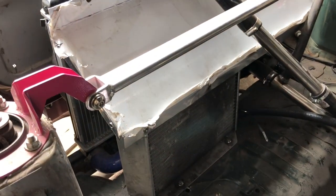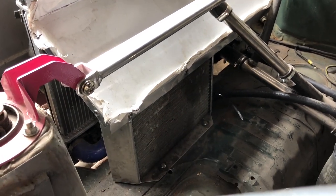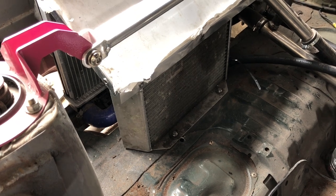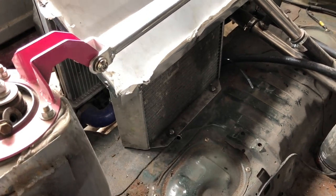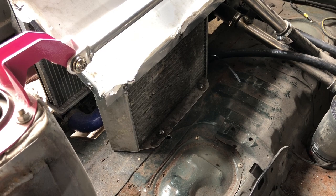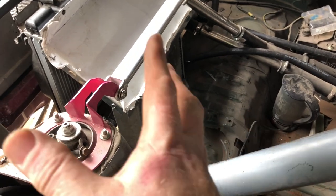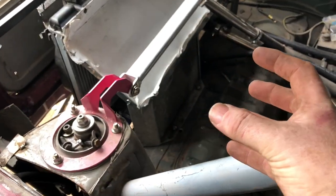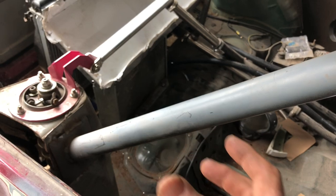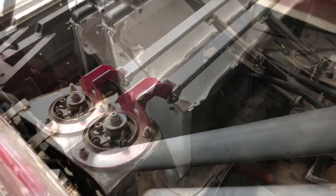Now we can start making the sides and front, which should be fairly simple. I could even reuse the rivet nuts we've used there if I want to go straight across flush — that could be an option. Though I do think I could do with a bit of space before the radiator for the air to expand, otherwise the tube is going to be right up against the radiator and will only flow through maybe a hundred mil area instead of expanding out a bit. I think I made a bit of a mistake there.